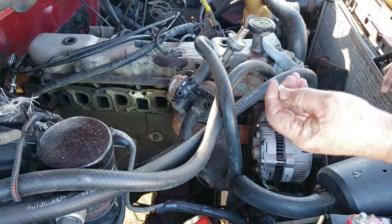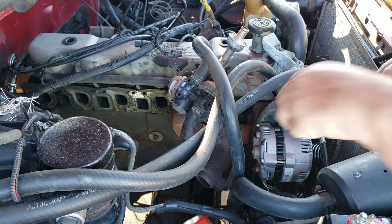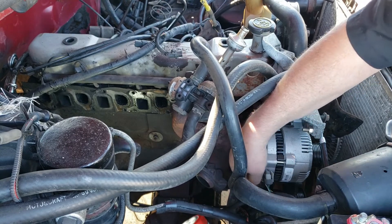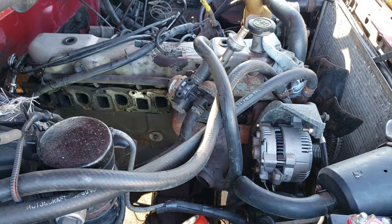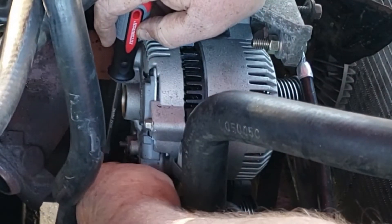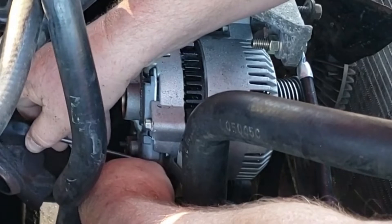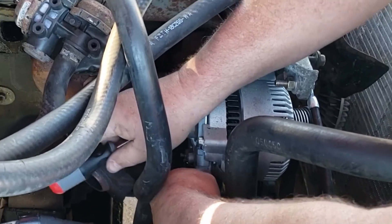This little teeny bolt here — which is a 10 — what you want to do is be careful when you go to tighten it down, because you don't want to tighten it down too much or you could damage the alternator. This is just a plug — comes out like that. This is another plug — that was a little difficult. Come down here and I'm going to gently pull on this wire while I get the screwdriver in this end to help that clip unplug — just like that. Be careful with it.